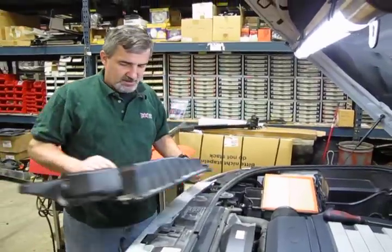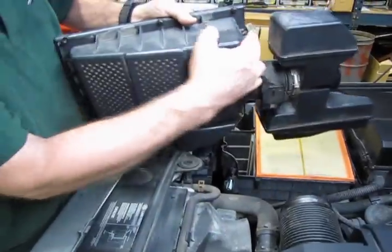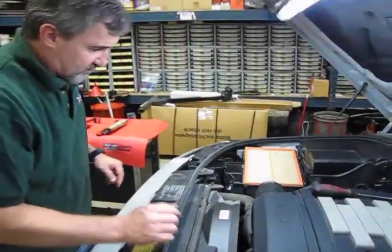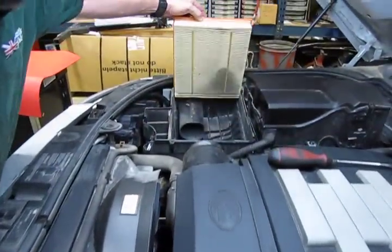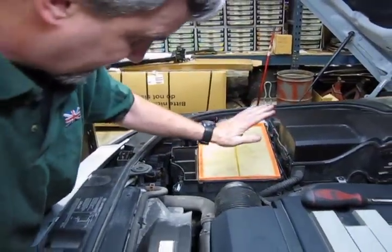Move that right out of the way. Some of you may find that the wire for the mass airflow sensor is taped to a white tab, so make sure you've released that before you take this cover off. Next we're going to get to the shroud. Quickly — now that you've got the air filter cover off, take a quick peek at what condition your air filter is in. This one is moderately worn but we'll get a little more mileage out of it; if it's really dirty, now's a good time to get it changed.